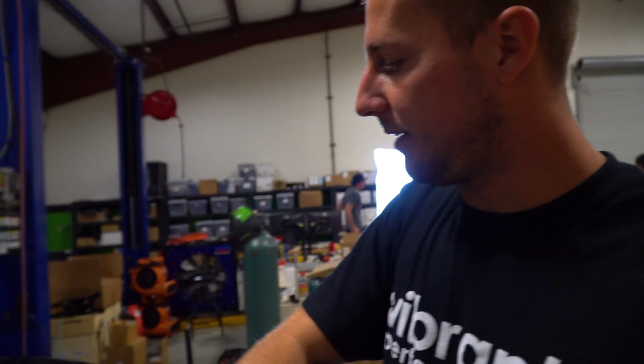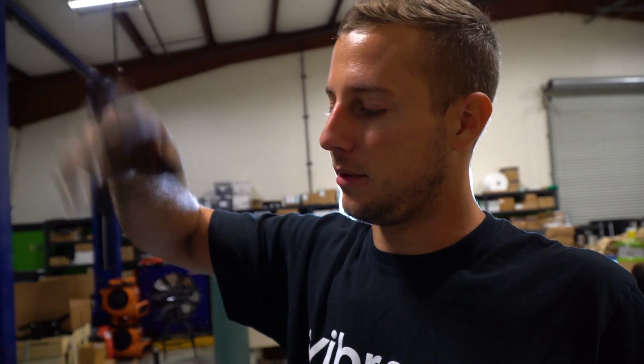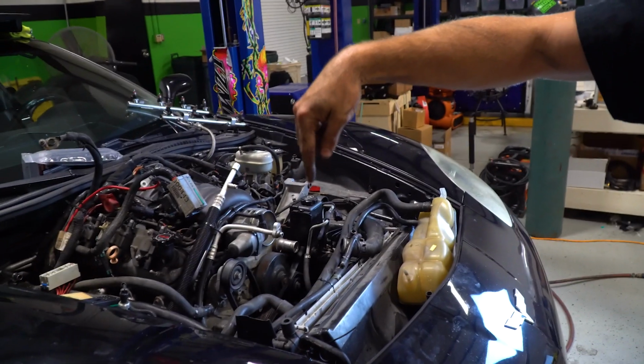Can you talk about how Corvettes don't have springs? Yeah, they have this big leaf spring that runs from one side of the car to the other that has bolts on it that stop the lower control arm. So that kind of serves as your springs on both sides, and the shocks just obviously help to control the rate. What's cool about them is that the bolts on them, if you just back those bolts out, you can lower your Corvette. It's nice and easy.